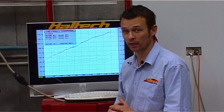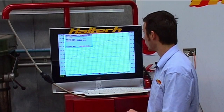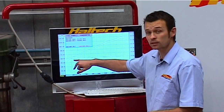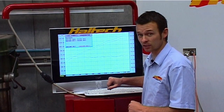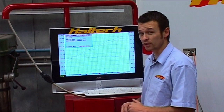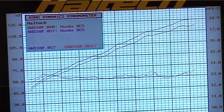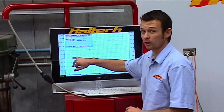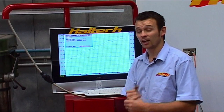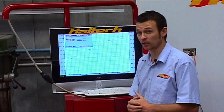It's not the same when we talk about ignition timing. What we have here are two separate dyno runs — same air-fuel ratio, except we varied the amount of ignition timing we gave the engine. In this case we decreased the ignition timing by 2 degrees, and you can see there's quite a change from the first run to the second run. Across the board we lost about 4 or 5 percent. So as you can see, ignition timing makes a big, big difference to the amount of output power that the engine makes.